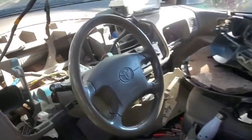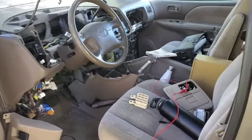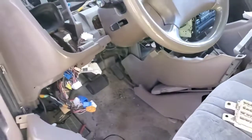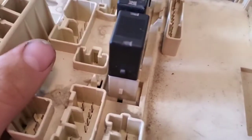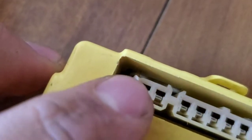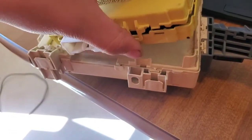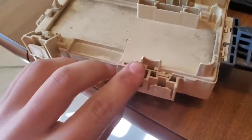Everything is so taken apart. There's our junction box, so I'm going to take that out. Looking at more wires and diagrams, I found out it goes through the integration relay. This is the integration relay — it goes on the board here. And you can see this pin here is all melted out. It was sitting on here kind of disconnected, hanging down a bit, which may be why it was a loose connection and melted. And this connector that holds it in is broken.